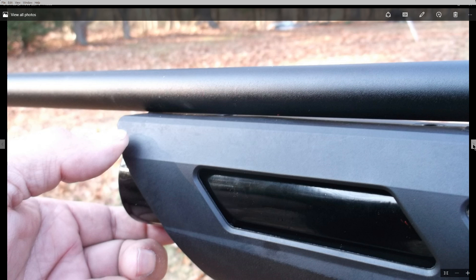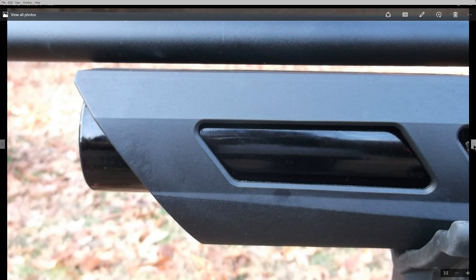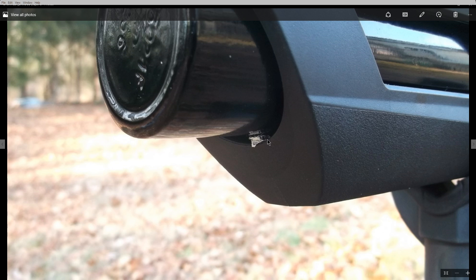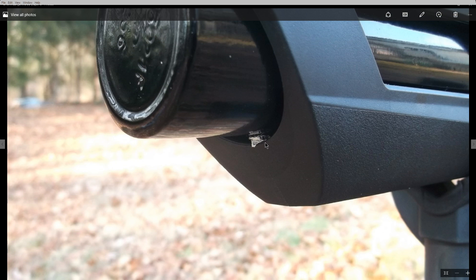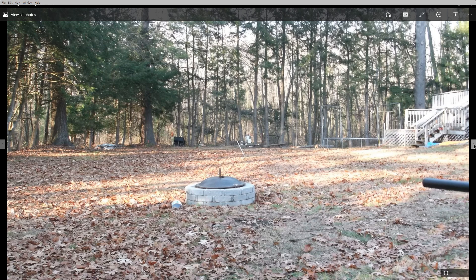Here's what I'm showing you: when you let go of the shroud, you can see it's touching the barrel shroud. From the front, what I did was put a temporary shim between the tank and the shroud — that shim holds it down so it maintains the gap. You can use anything as a shim: electrical tape, a piece of foam, a piece of plastic, a door edge guard — anything to keep it open. It's another video for me to show how I corrected mine more elaborately, but electrical tape wrapped around the tank works fine.